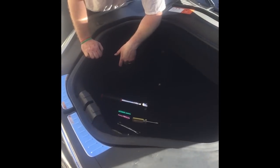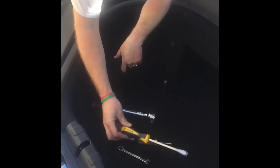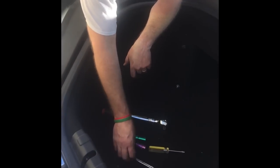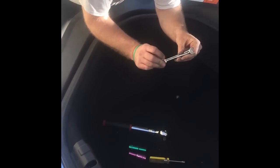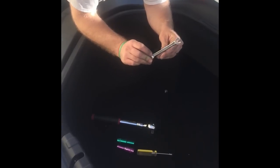All the tools you're going to need today to do a 12 volt battery swap: a flathead screwdriver — recommended, not necessary, but recommended to have on hand — and a 10 millimeter wrench to remove the negative terminal on the battery itself.